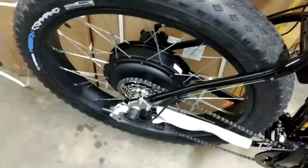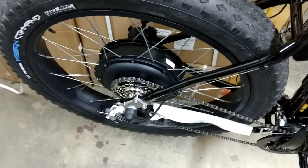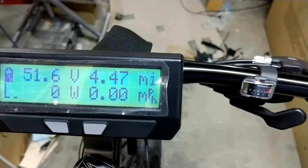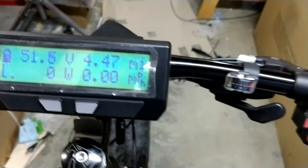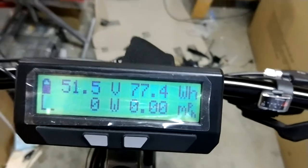The nature of the six-turn winding is that it is high torque and low RPM for its winding. That's why with a 51 volt battery and the particular winding of the motor, our top speed is in the low to mid 20s. But it will have good torque.